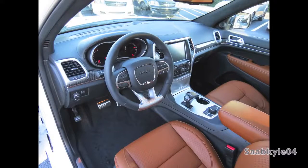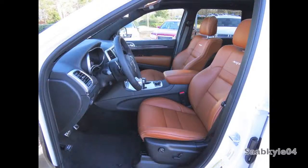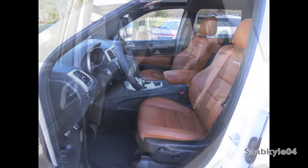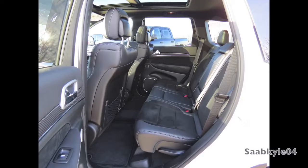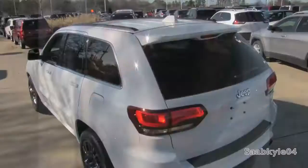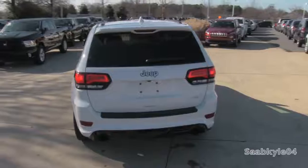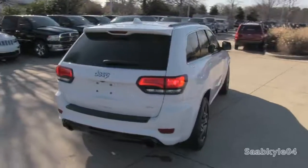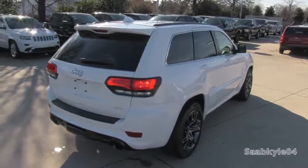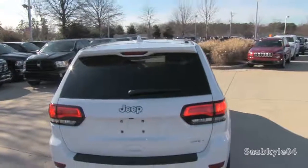It features 5 driving modes controlled via a rotary dial in the center console, just like the Terrain setup: track, sport, auto, snow, and tow mode, in addition to activation of the vehicle's launch control. Each mode has its own damping and shift mapping based on driving characteristics, road conditions, or if you need to tow something. In auto, sport, and track, torque proportioning varies but is generally rear-wheel biased, except in tow and snow mode, where it's distributed 50-50 between the front and rear.